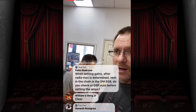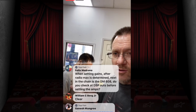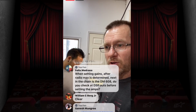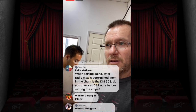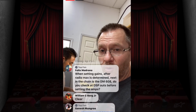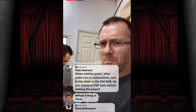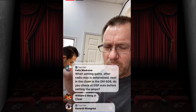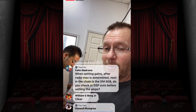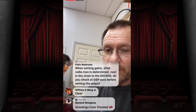If you don't take that into consideration, so if 1,000 hertz was lower than everything else, then you just gained everything else up substantially higher. That could be bad. So you have to find out where your highest output is, and then use that to figure out what you're going to do, or keep your gains down as low as possible from the get-go, and not worry about getting that little percentage of gain output. That's really the only way to do it. It's a pain in the butt. Yeah, it is. So, got to be real careful.